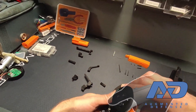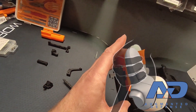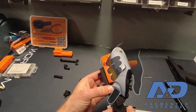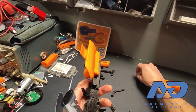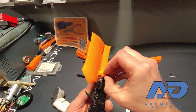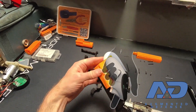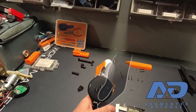With that, the controller — to make sure this locks in — what we're looking for right here is you want the tiniest bit of play so that you have movement right there. The reason it isn't coming all the way back is we haven't put in our 0.8 spring. Our 0.8 spring is going to go here. If you wanted a super light trigger pull you could put a 0.6 there, but in order for this to feel more realistic we want our 0.8. So here we've got our pull on there.